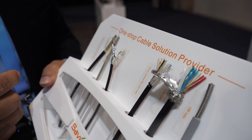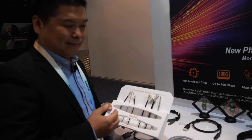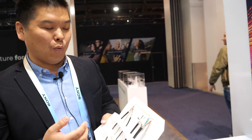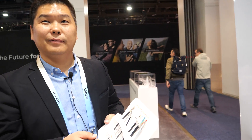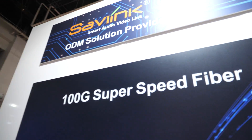Hybrid — so you bring the power and the data separately? Yes. The USB-C cable can carry 100-watt power delivery over the copper, and the data is 10 gigabits. You cannot do 100 gigabit Type-C — it should be 10 gigabit Type-C. But maybe you can make 40 or 80 gigabits later? Yes, we have 40 gigabits already and we are launching it in Q1 of this year.